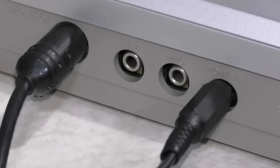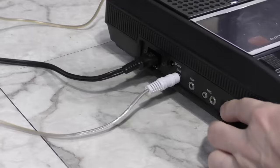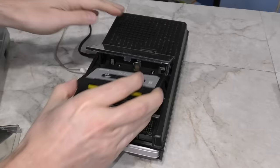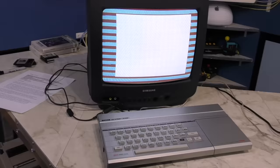So let's try loading a cassette-based game instead. I'll connect up the cassette recorder. If you just wanted to load pre-recorded tapes with games, all you'd need is a single cable connected to the ear on the back of the computer and to the earphone output on the cassette player. Almost any cassette player would do, even a Walkman. If you wanted to save as well, you'd need another cable connected to the mic. To load a game, just use the load command followed by the file name in quotes. If you just type two quotes with nothing in between, it will load the first file found.